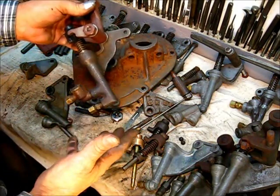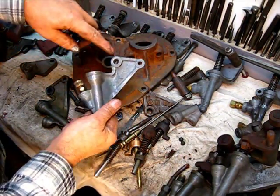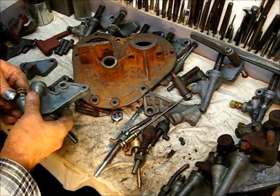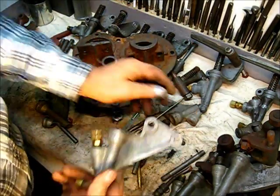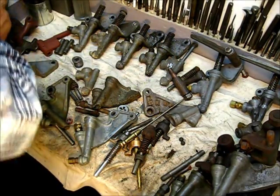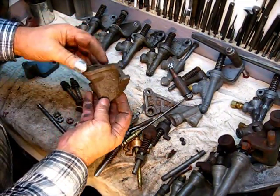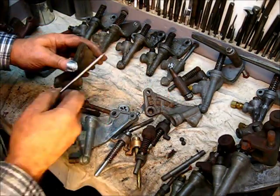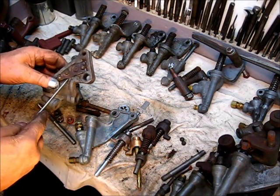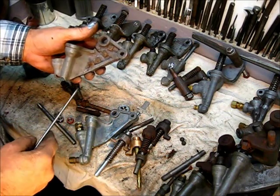The later model pump that is the equivalent to this, and that will work on this housing, is this pump here. As you can see, it mounts — the dowel pin would go here and the rocker would go here. This is the pot metal version. You will find these in really bad condition. A few examples: there's one probably frozen and busted, there's one where the bottom broke off of it, and they just fall apart. This one has had a repair at some time — it's a good repair, but you can't salvage them with a repair if they broke in the wrong place.